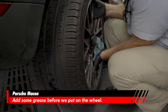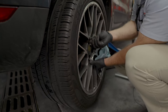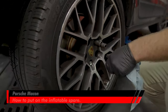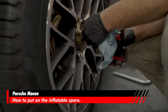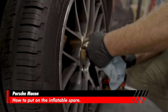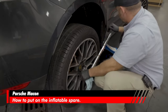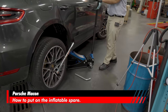We're going to put the wheel on here. Turn the lug bolts on a couple of threads, then take the impact gun and spin them on to where they stop — in a star pattern. Then we're going to torque them. Gently set the tire down.